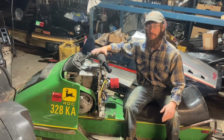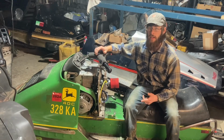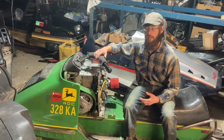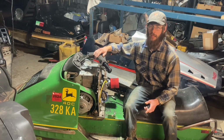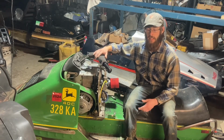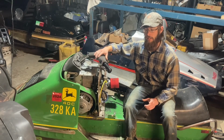Well, it basically took me until the snow was completely gone, but I think I finally got her dialed in. I did stick with the 35 pilot jet, and I did end up going up another couple sizes on the needle jet to a Q-0. And then with that, I also had to bring the main jet back down to 210, seemed to be where it was the happiest. I guess the main thing that I learned was the importance of the needle to needle jet relationship.